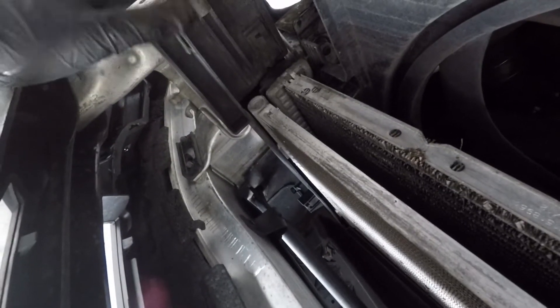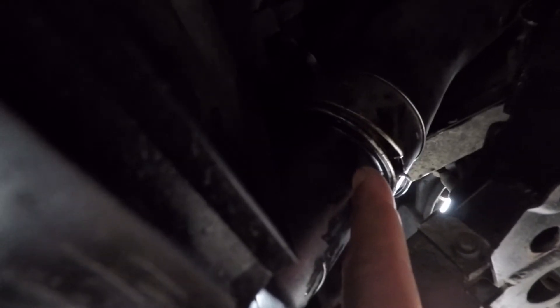Now I'm going to fit this one on. Here's the new intercooler fitted in. Always check that you've fitted the pipe on correctly — once you fit the pipe on top of the intercooler, the clip will click into place and you'll hear a click.